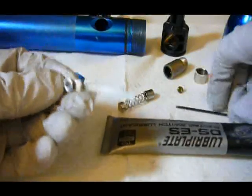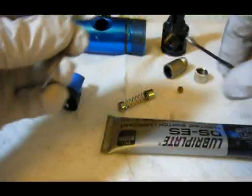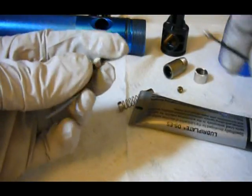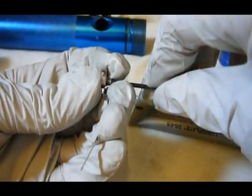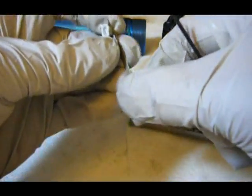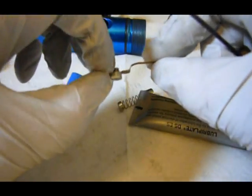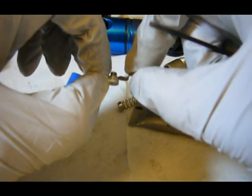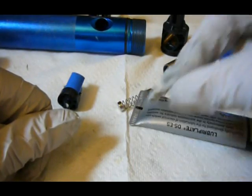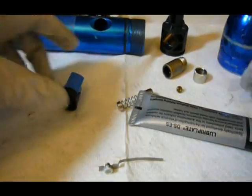Now I'm going to work on the sliding contact. I'll remove the Allen screw for a moment, put some grease onto the threads, and put that back in. I'm going to make sure that when I do put it in, that pointy thing is pointing downwards and it's barely screwed in at all — that's so when I put the whole housing back into the Maglite it doesn't get caught and scratch the inside. I'm going to set that aside for a moment.